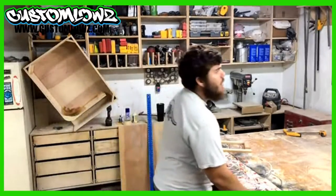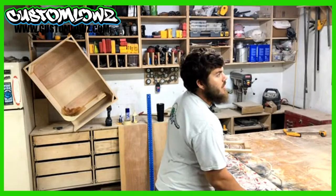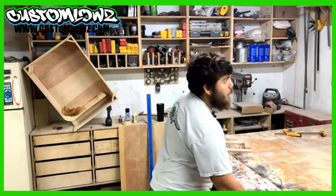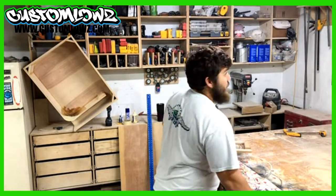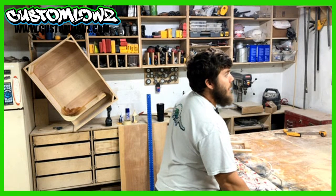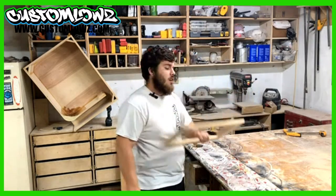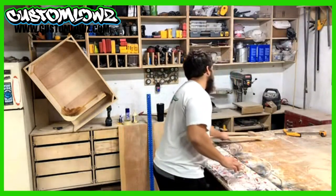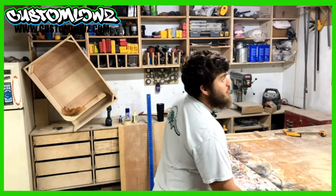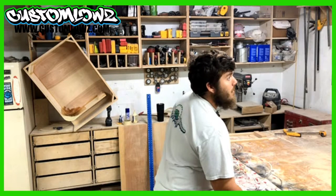Like I said, we're working on a box for four Scar Audio ZVX8s. We already have the main structure of the enclosure basically done, as you can see. I'm waiting on some fiberglass resin and mat to dry inside that Kerf section. We already cut the window brace, we've got it right here, but we can't put that in until the fiberglass dries. I'd rather just wait for that, so we're going to start figuring out our baffle.